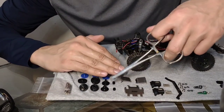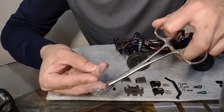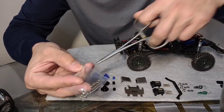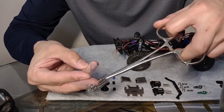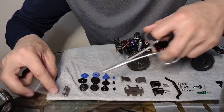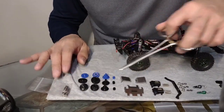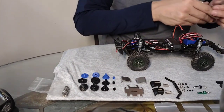So the kit itself is just three gears - let's call them trail gears. It comes with ball bearings and these little retaining pieces to hold the gears in the transmission. I'm gonna put all this in the transmission. They're all bearings - I'm gonna grease them up to make sure they don't get rusted out since we already have metal-on-metal contact here.